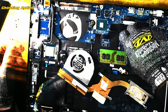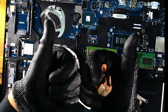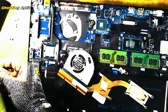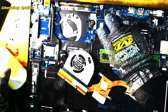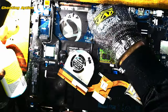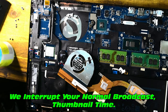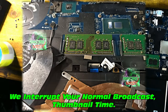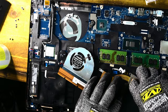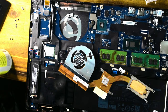Right now we're removing the somewhat burnt-on, well-run-in thermal paste. That's nice and shiny — perfect. We'll clean up each component even if they look okay, as we definitely want some fresh paste while we're here. Cleaning the GPU chip — dabbing isopropyl alcohol onto the cloth rather than spraying it on the computer itself, so as to avoid any potential problems. The battery has not been removed — it should normally be removed.